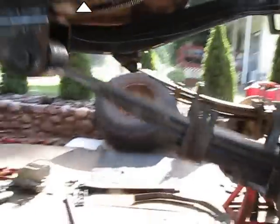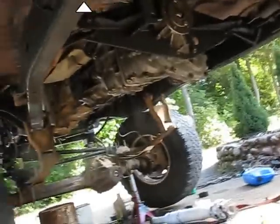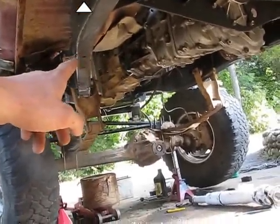Box time, and then maybe I'll start mapping out the exhaust. I'm not sure where I'll be popping out with it. I can't go back any further because the gas tank's there and there's shocks there. So I might dump it right here. I could fit a muffler right at the very front — have that pipe come off at a 90 and go right into a muffler, and then straight out here. That could work.